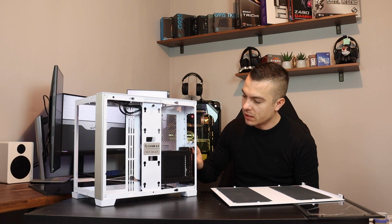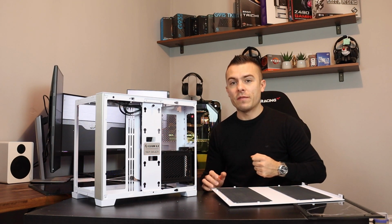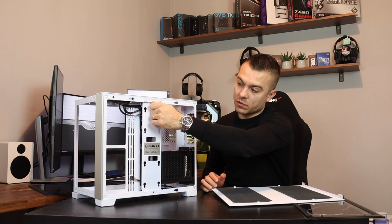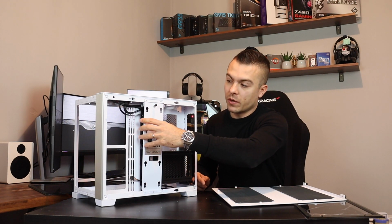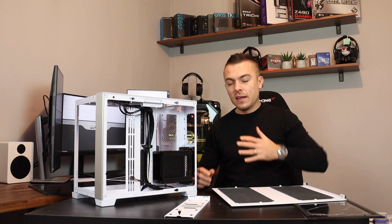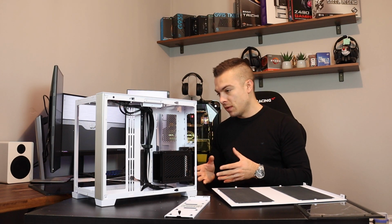Basically, yeah, that's quite alright. And in addition to that, you can place right here two additional 2.5-inch SSDs. The side mounting, the middle one, is attached to the case with the top thumb screw, and you have one here at the bottom. So removing the bottom screw and untying the top thumb screw, you get access completely to the back side. And this is really cool just because you can rearrange the cables easily, placing the power supply up here or down at the bottom.